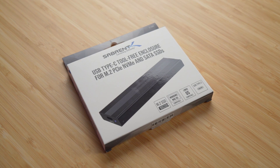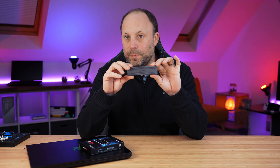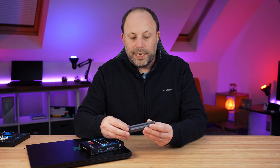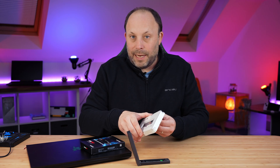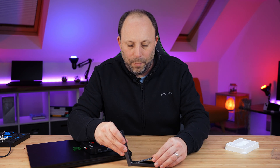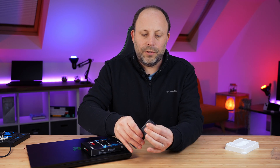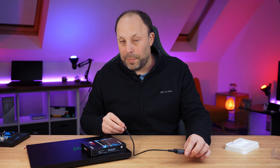Lastly, I use a USB-C caddy — this is a Sabrent tool-less version. You don't necessarily need this, especially if you've got more than one SSD bay, as you can clone directly from one bay to another. But by cloning directly to this USB-C drive plugged into my laptop, it means I only need to open my laptop once. Once you've got all your equipment, install the SSD into the caddy. The Sabrent is tool-less, so you just pop your SSD in, flick the lever — it's now secure. Pop the heatsink closed and plug in the USB cable to your PC or laptop.